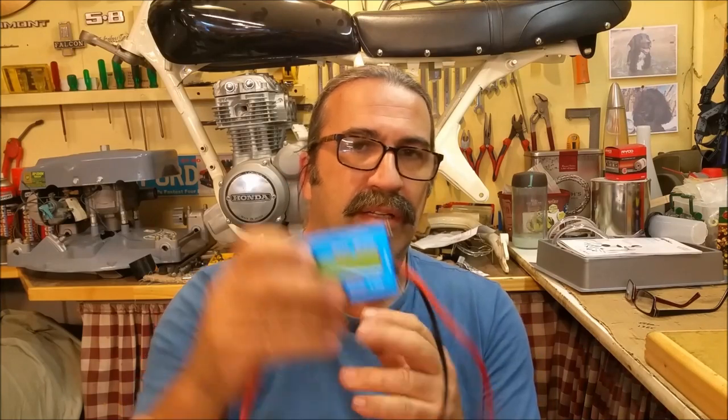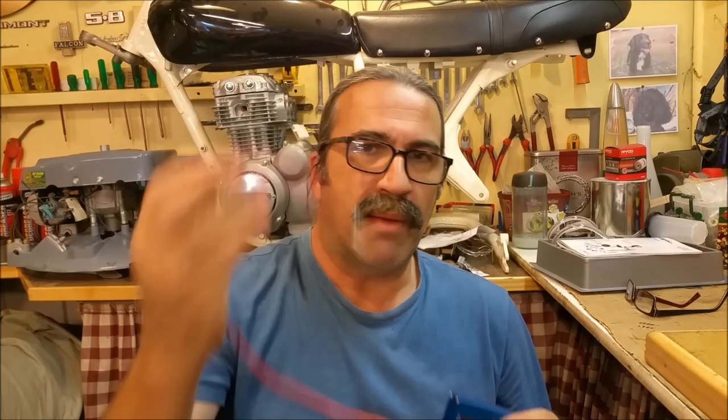The Plymouth was one, and the Falcons as well, where I used an inline ammeter, and you can hook up a wiper motor, or a heater fan, or whatever it is you're using, like an electric fan for the radiator, and you can see what the current draw is with this and choose the wiring appropriate to the circuit you're doing.